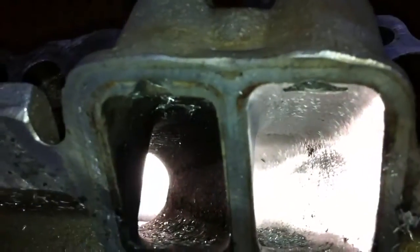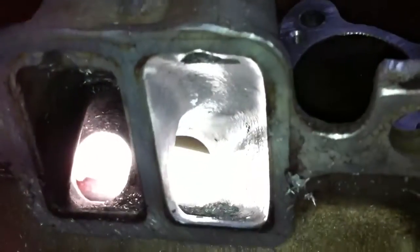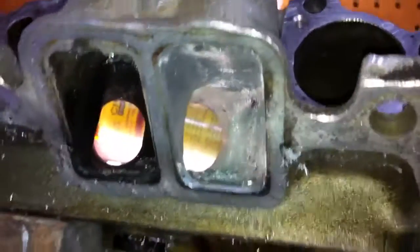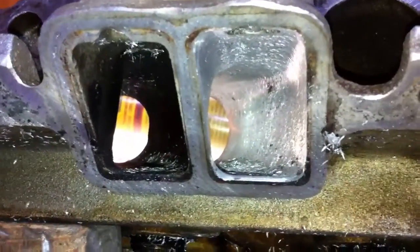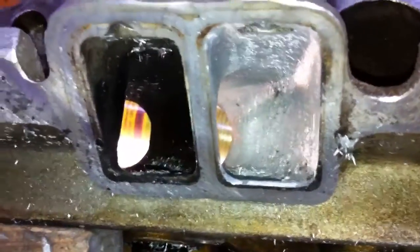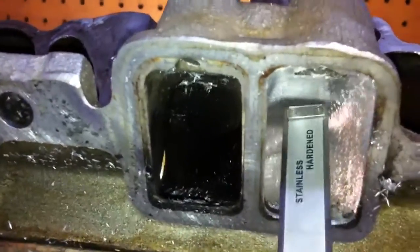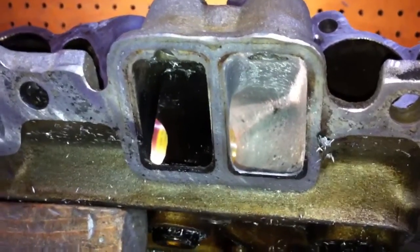See that line right there — it kind of goes through the center of the other side of the port. And over here you can see there's so much less there; it just straightens out that port for an easier path for the air to go into the cylinder head and into the combustion chamber. Also I've raised all of this in here all the way through — more airflow, straighter shot.